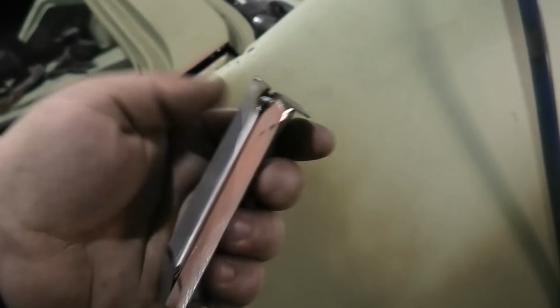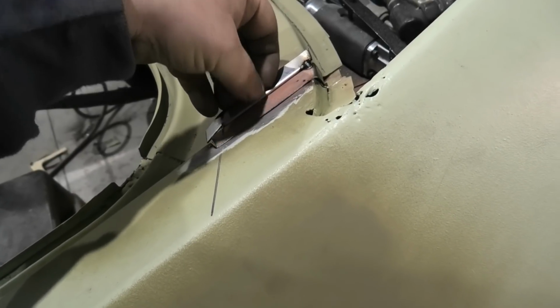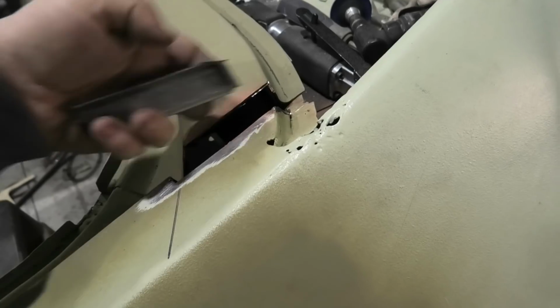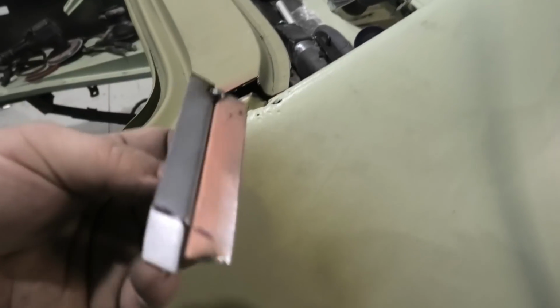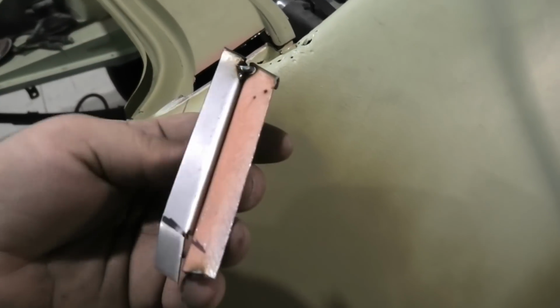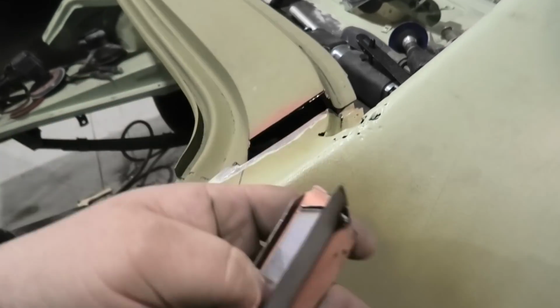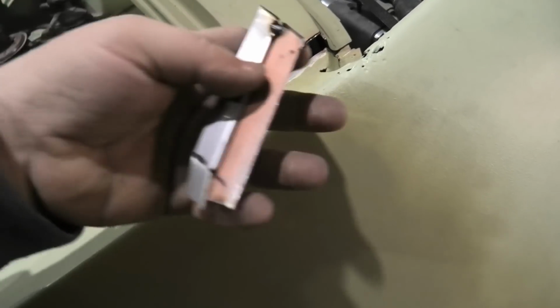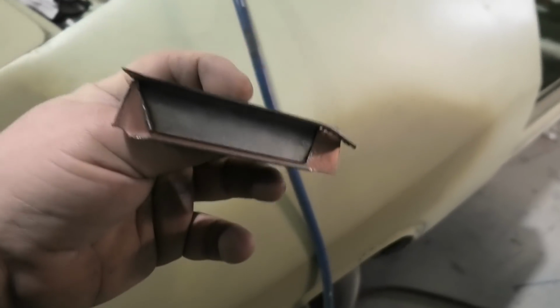welded together, and then I'll grind that little guy out, and then we can stick this back in the hole and weld it all back together, and we'll have the thing looking pretty much bang on. And I just do that to both sides, and then that top panel will be done, because effectively that's what's missing off the ends. One, it's luck of the draw really, whether or not you're going to get one long enough, but two, that little fold that kicks up is actually the fold that goes down. But 9 times out of 10 most people just run a weld straight through effectively that groove there and then grind a groove into it, but I really like to do it properly, so I'm going to spot weld that and stick it in.